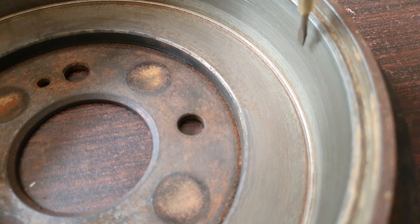You can try a more aggressive sandpaper on the drum. If that fails, get the drum resurfaced — they will remove a layer; you don't want any scoring or deep grooves. If that also fails, the drum may be heavily warped and needs replacement. With resurfacing you can only do it a few times; there is a limit after which you have to replace the drum.